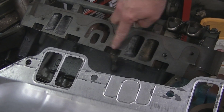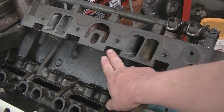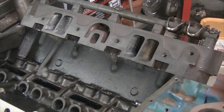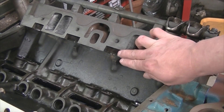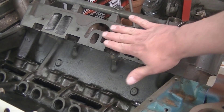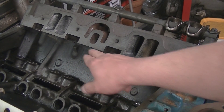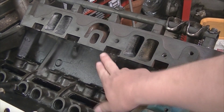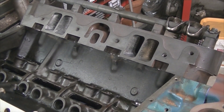In the section where these are wide open I'll have material — I'll bend the tab up to custom fit it into each one of these slots, so I can have some material there that I can silicone and seal off, and then also use Hughes gaskets for the intake which actually cover those slots. I think it'll be more robust than their plate. Effectively what they're doing is relying on the gasket to block that port off, putting silicone between the metal and then between the metal and the fiber gasket — which is a weak point. If I bring sheet metal right up close and silicone it with the gasket on back, that would be a way better solution.